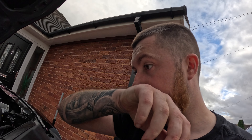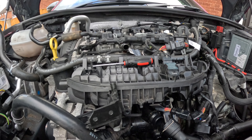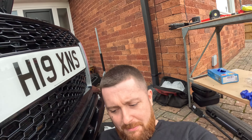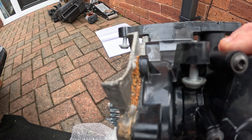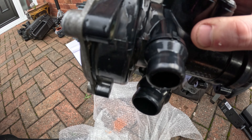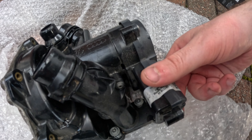Now we're on to the final removal step — five T30 bolts holding the water pump to the block. There are three up top and two at the bottom, which are quite awkward to reach. With those five bolts out, the water pump and thermostat housing comes out. You can see where mine's been leaking — it's gone rusty and there's a split. Good job we're changing it. These are electronically controlled, and there's a plug underneath to unplug once you've pulled the unit away from the car.